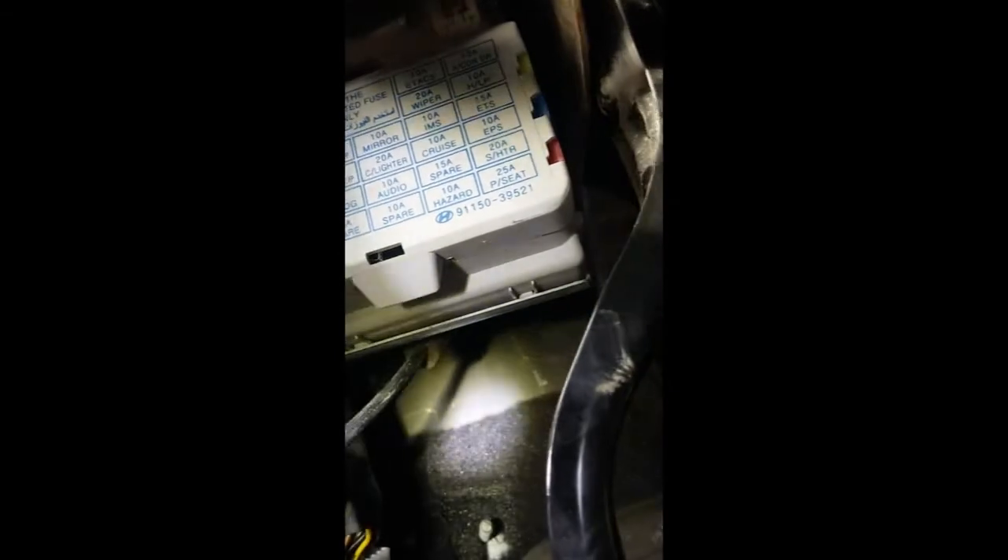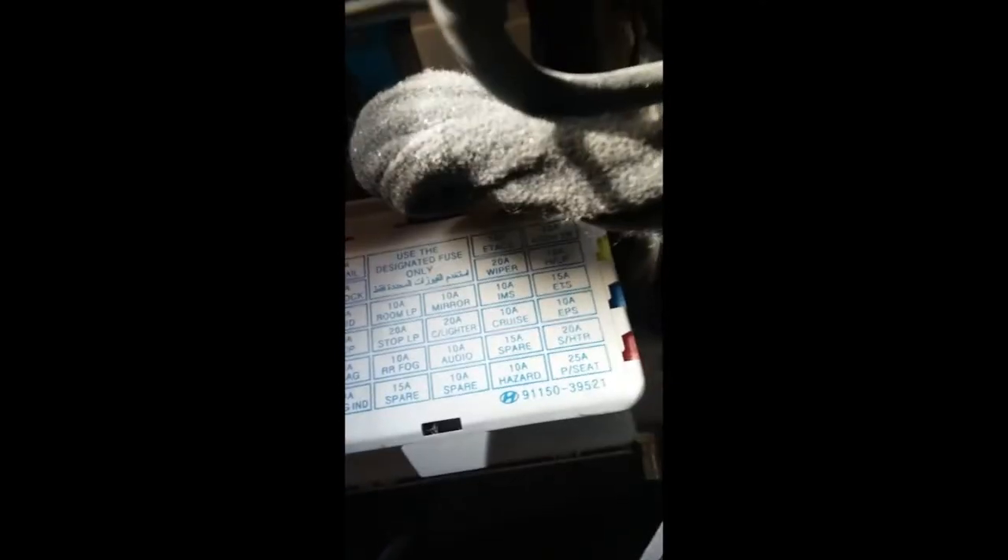Pull this thing down. You're probably gonna have to remove this emergency brake assembly, and then once you get all of that done, you can hit the little release tab and remove the electronic programming module — where the little switch may or may not be hidden beside or behind some of that plastic that holds all that stuff together. Or just go pay someone $50 or whatever they want to program the thing. Good luck.